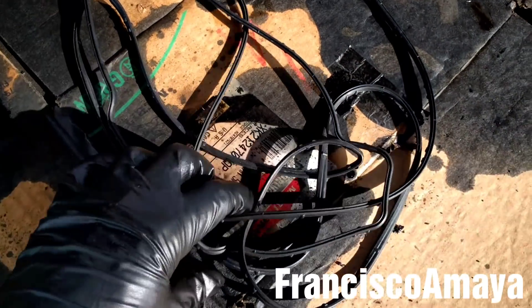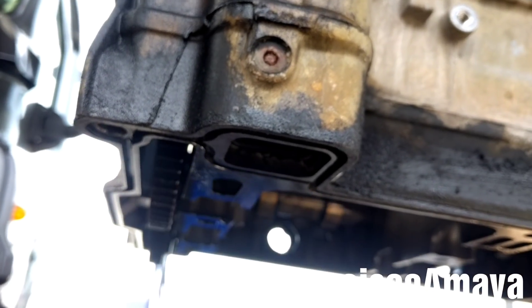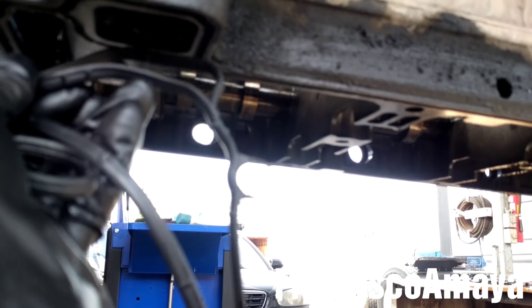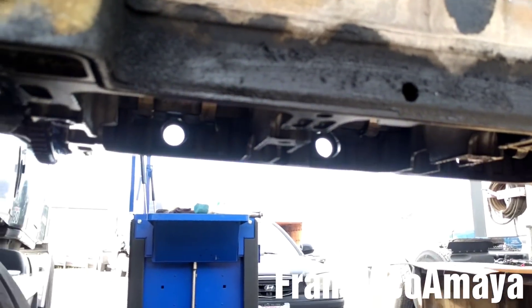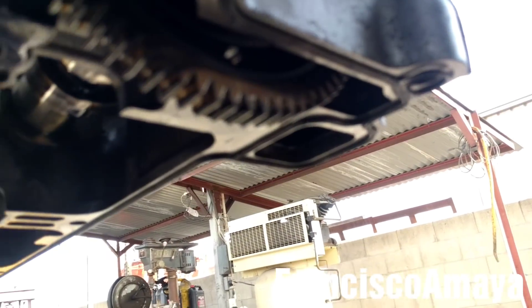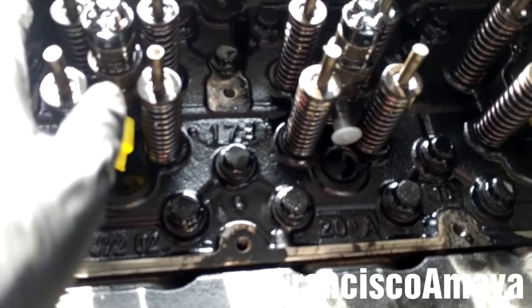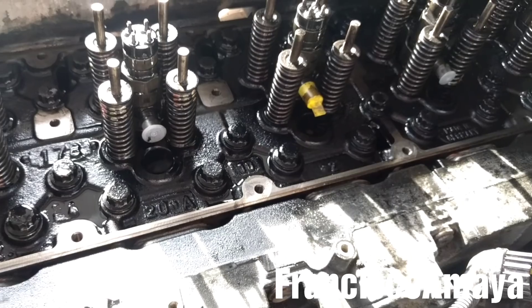I have the new cam housing seal. I won't give you a part number this time because the cam housing seal varies depending on the year of the DD15. To install the cam housing seal, look for this oil drain orifice right here — we have the same thing on the other side. Start by placing the seal in this position because it's easier to start from here, then keep following the seal around the cam housing. The new cam housing seal is in place — make sure it's properly aligned on the housing. Now on the head, clean this area very well. Remove all the oil and blow compressed air to the thread orifices to remove any excessive oil.